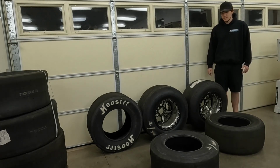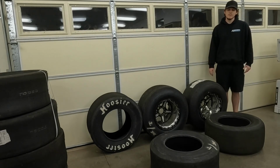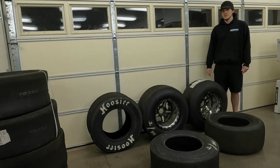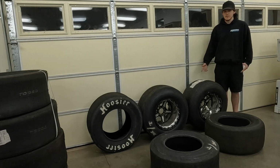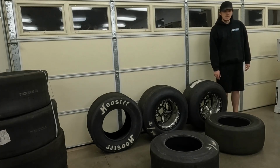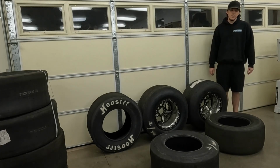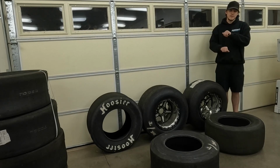And I will also tell you that on that car, like I said, we had the same tune-up on both of those passes. The biggest difference was the tire. We also had some differences in the suspension. Of course, we had it separating some on the radial, because that's what they tend to like. And also because on the radial, with that stiffness, you can hit the tire harder without wadding it up too much, and it will take it. So you can hit it harder with suspension and with power.